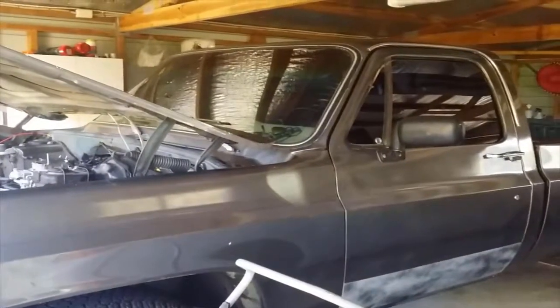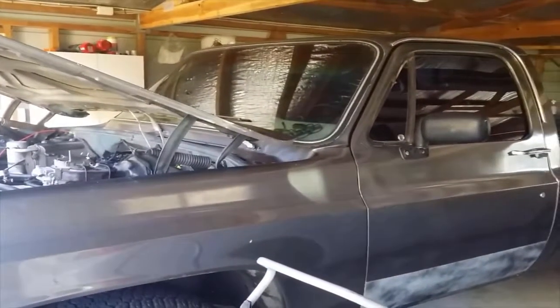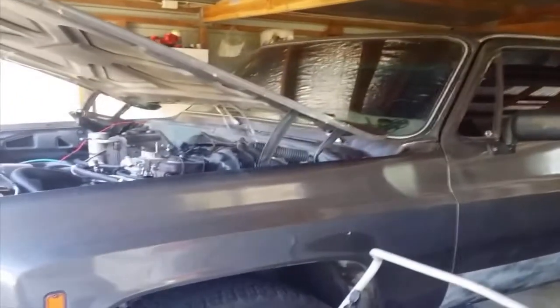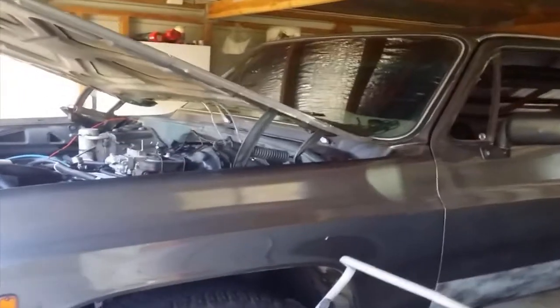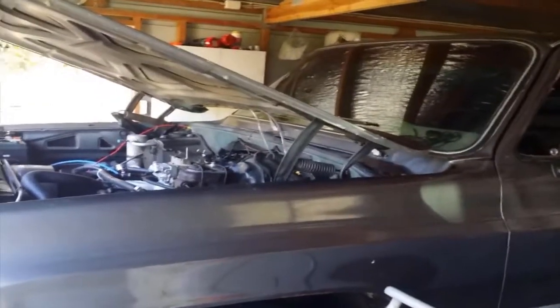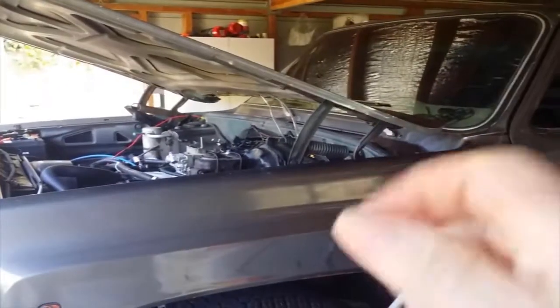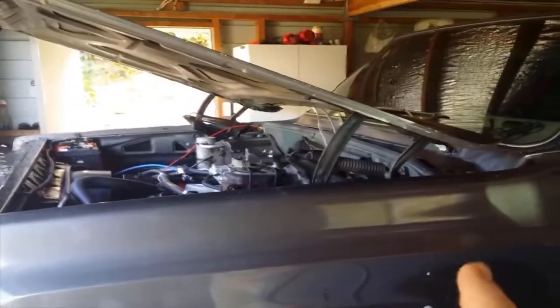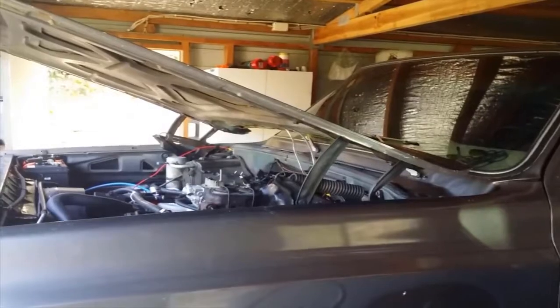Okay, it's the 26th of the 8th, 2017. This weekend I'm just going to do two simple tests. I'm going to find the wire that goes to the starter motor solenoid and turn the key on to see if there's voltage supplied to the solenoid, and when I turn the key off, there should be none. That would mean the ignition switch is proven to be good. If the ignition switch is good, I'm going to take the starter motor off and inspect the solenoid.